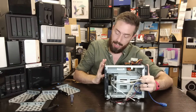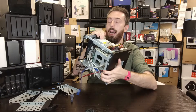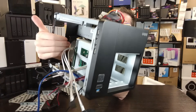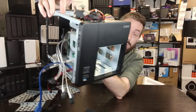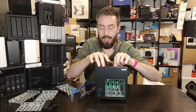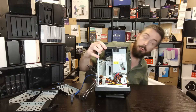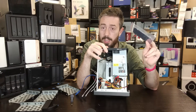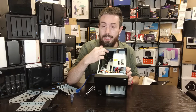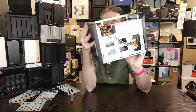In terms of ventilation there's absolutely tons going through to the back. Interestingly, when you install your motherboard, you've got direct access at the standard angle to that PCIe slot at the top — you won't need a riser to reach it. Once everything is installed and cables are in place, there's actually a decent amount of space to play with. You can use the side panel plate for a 2.5-inch drive, and with the right riser you could install quite a large M.2 NVMe card in the top-level cavity.